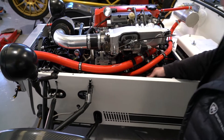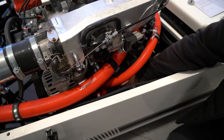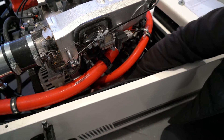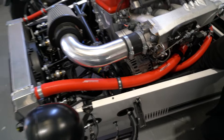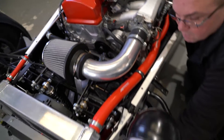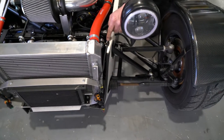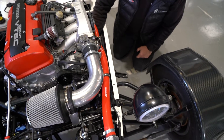The cold side is unfortunately tucked down here. It comes out the main thermostat housing here as well. This has a 90-degree bend into a 32mm tube joiner here, and then it runs along to the very bottom of the radiator. The bottom of the radiator joins along — it's just under the alternator, and there is a fixing point for that.